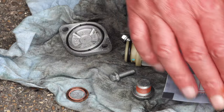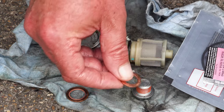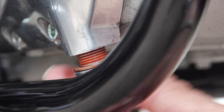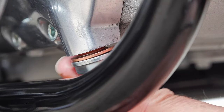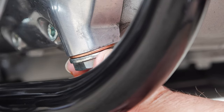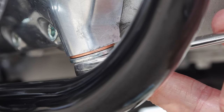It's then time to refit your sump plug, not forgetting to put a new copper washer on it first. Clean the area thoroughly before refitting, then fasten the sump plug back in finger-tight only. Just like the other threads I encountered, this was a very positive thread — you could get it almost all the way in with your fingers, with minimal spanner pressure required to affect a good seal. Again, 1/16th to 1/8th of a turn only.